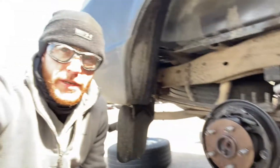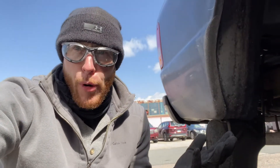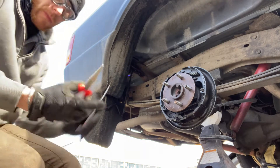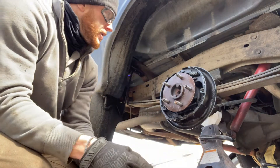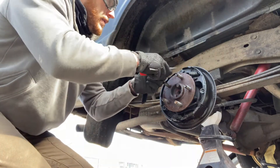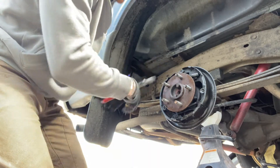Alright, I'm going to start taking springs apart. The reason I have safety glasses on is because these springs like to fly and hit you directly in the face, and usually your eye is connected to your face. I'd rather look like a goof or keep an eyeball - I pick my eyeball. That's why you need the pliers and a flat head. You can use a bigger one - I do have a bigger one just in case things get squirrely. So basically these are all you need right here. Just start taking stuff apart. You got one spring here.